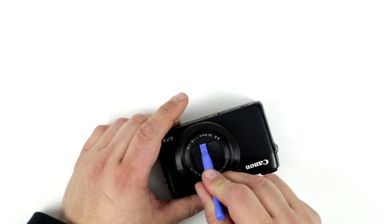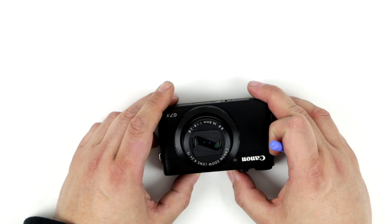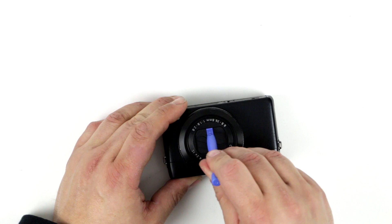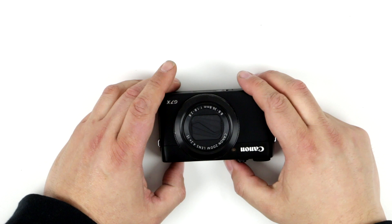We're going to do that to all four corners and hopefully that's going to unjam it. We open it and it doesn't quite work — you can see it's still getting jammed. So we're going to go in and pry the corners again, moving in one direction. A little bit more force this time, but not too much, because if you damage it you'll essentially have to send the camera back to Canon. We work our way around slowly with just a little tiny bit of force — you don't want to wrench on it — and then press it again, and there you go.